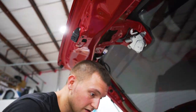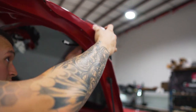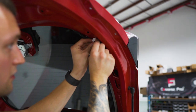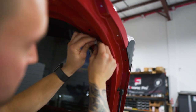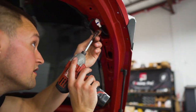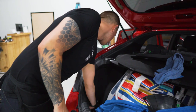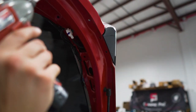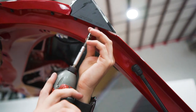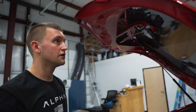Put the taillights back in: wire in, line up the holes, give it a little tap. I like to plug it in before screwing it in, just to hold it in place. Remember this slides on — clips in. 8mm: the silver 8mm goes inside, and then we have the four black 8mm including the camera piece. With the taillights, you never want to over-tighten these on any car — just one little click with the impact. If you over-tighten them, you can crack the housing and get water in your taillights over time.